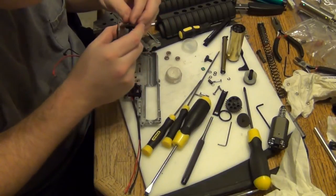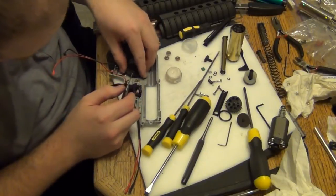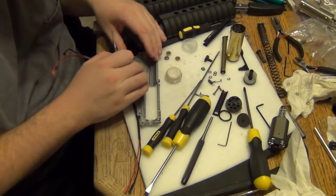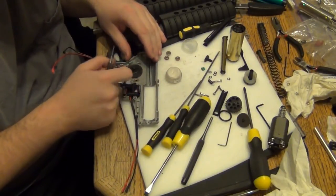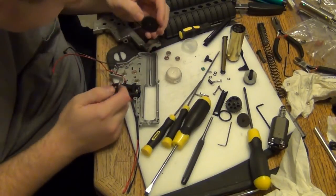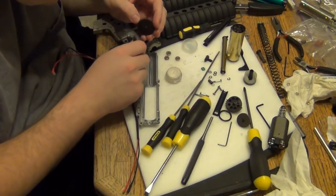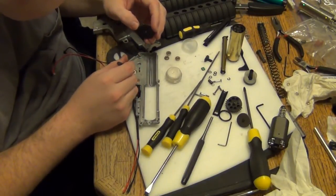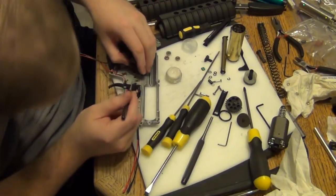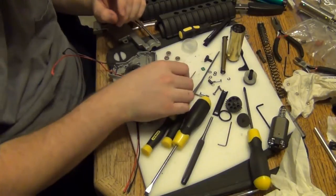So a good practice to make your shimming really good: start at one gear at a time and then start connecting them like a puzzle until you've got it perfectly shimmed the way you want. Once you've got it perfectly shimmed, you don't need to shim it over again. If you ever open up the gearbox and check out some gears, you might have to shim at that point, but everything else you're just never going to have to shim, and it'll be easy to put back together.